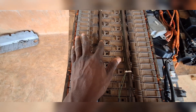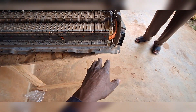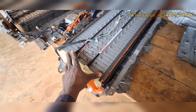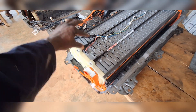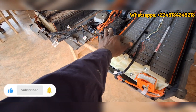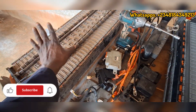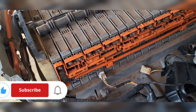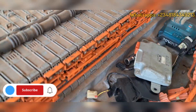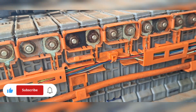The Venza design has ridges on it while the Camry has a smooth flat surface. You can see the markings here showing they had replaced cells on the Camry battery before. Module-width-wise, the Venza module is as wide and thick as the Camry one, so we'll be doing a direct conversion. The polarities on both batteries are actually the same, but the designs are quite different — so we'll be doing a battery transfer. Taking out the plastic coverings on the bus bars, right off the bat you can see the corrosion is bad — the nuts are bad, the bus bars are bad — which will cause high resistance.